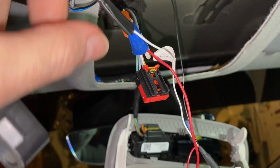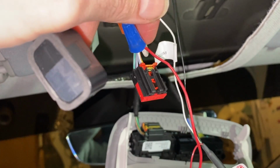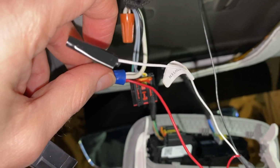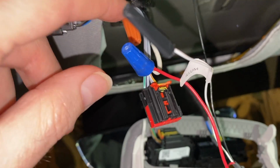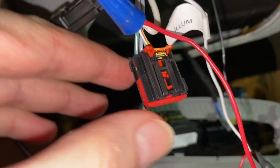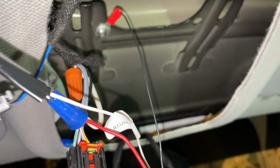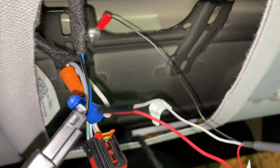And so we're connecting the red wire from the home kit to the white wire. I kind of did a split here, so I'd have a bit more wire because it's kind of short. And use the white and yellow wire. That's constant 12 volts. And the ground is hooked up over there. I actually didn't drill a hole at this point. There's a free hole, so I put it there. And then now we're gonna kind of put this back together. And the cable's kind of long, so we'll have to try to see if we can put it back here and just secure it down somehow.